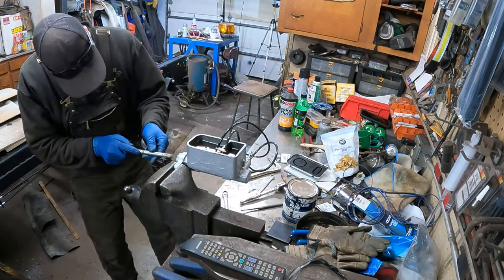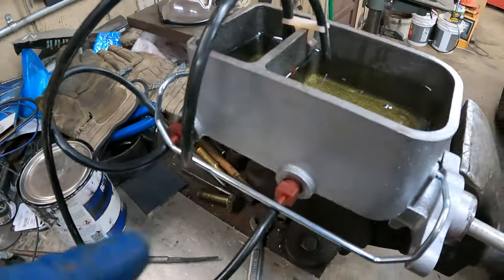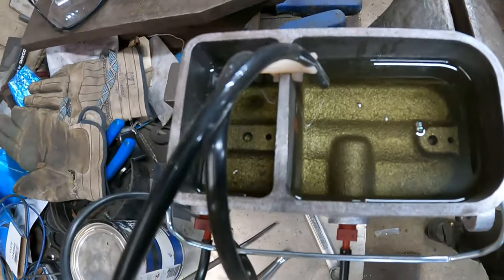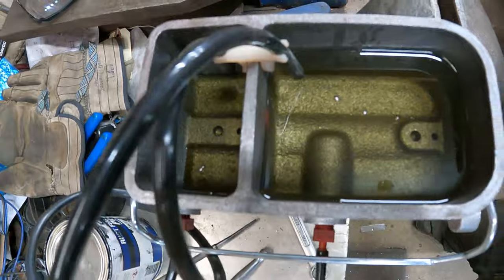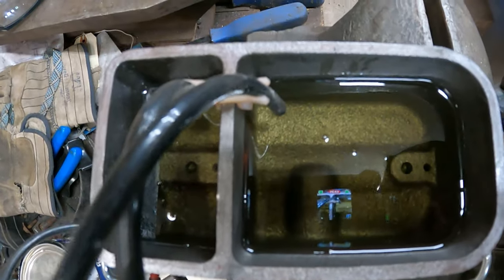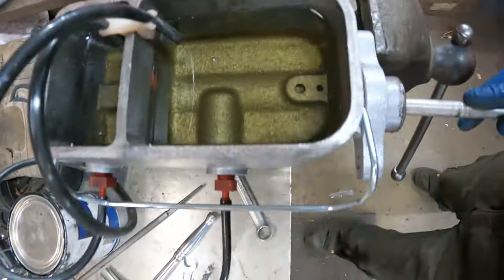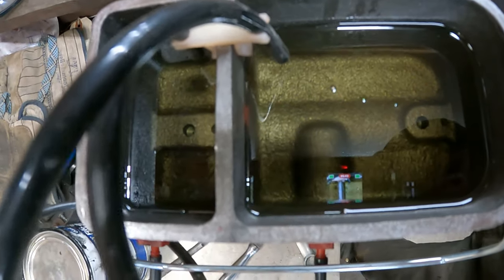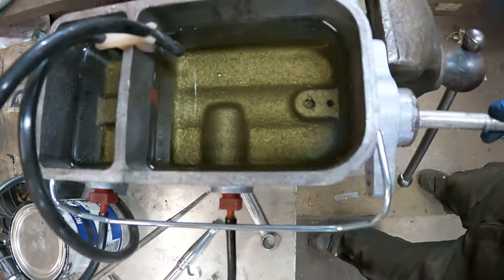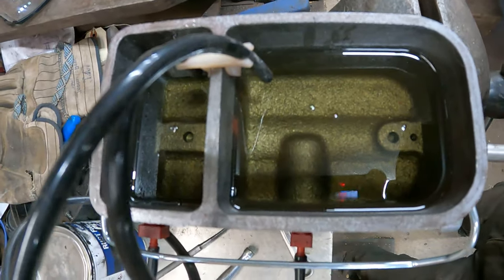I've got this piece of aluminum to push it with. Here you can see where the plastic fittings are in the hoses. We're just going to push this — there we go. Just push it in and you can see the air coming out of the fittings there. We're just going to keep working this until there's no air coming out of the system.